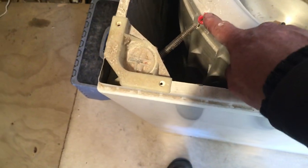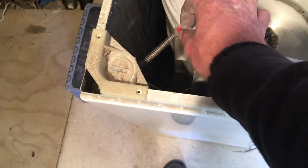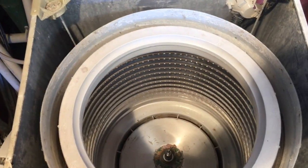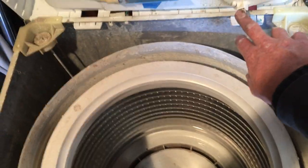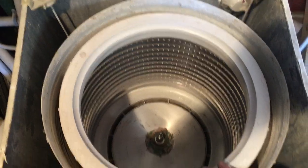What I would usually do in that situation is replace that clip, or if you haven't got a clip you can just drill a small hole and thread that spring through and bend it around on itself so it holds on there. That's a bias spring. What it does is it biases the bowl — instead of sitting directly center it moves slightly over this way, which is away from the out-of-balance lever in this corner, which is actually snapped off. It should be about that long, so we need to fix that. It's also used on machines that don't have out-of-balance levers. That's quite important.